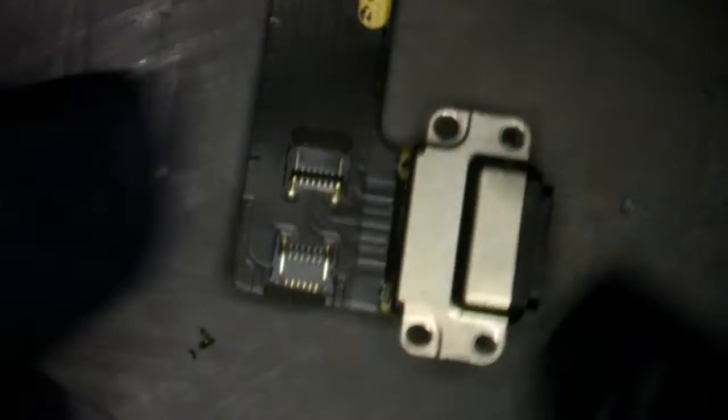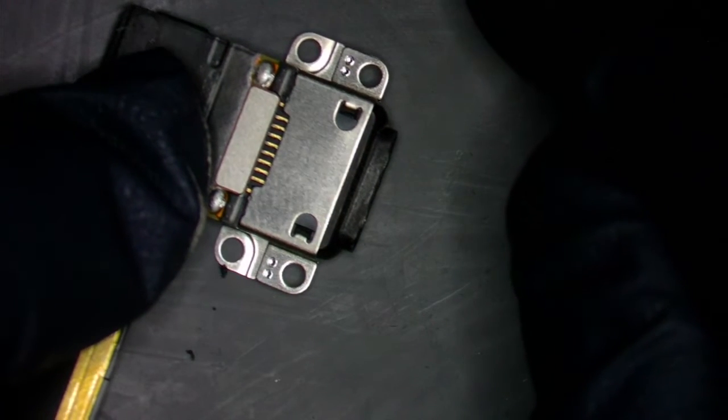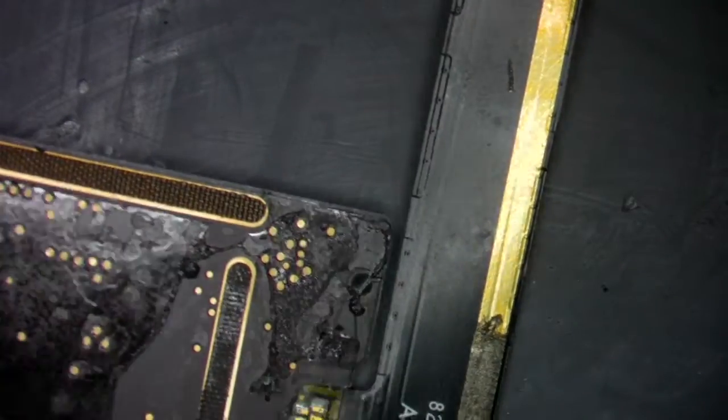We ran the TriStar tester and it passed, so I figured maybe it's some loose screws or something. Took it apart, tightened up the screws — same thing. So it's obviously this little portion right here that's bent and has damage. You can see the port goes through this entire flex and connects back here. The bend point is right about at the port, so there are probably damaged pins in there. It's too much of a hassle to try and desolder and fix it, so we're just going to replace the port altogether.